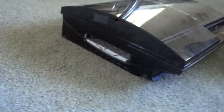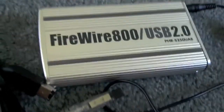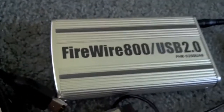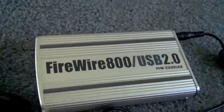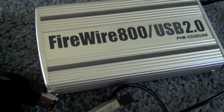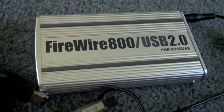It's $59.99 on MacAlly.com. It's a good way to repurpose the hard drive from your PlayStation. It's a very, very easy do — you get some great gratification from it. The only other thing you have to do is, if this is coming out of your PlayStation, you'll have to format it. PC guys, you probably know how to format. Mac guys, go to Disk Utility and use Mac OS Extended Journaled — that's at least what I pick. You can format it however you'd like, but you will need to format it. None of your files will be readable, so if you're thinking you can grab a game save off of this from your computer — no, you cannot do that. I was able to reformat that drive and turn it into a portable hard drive, and now I have another place where I can back up family photos, family videos, and stuff like that.